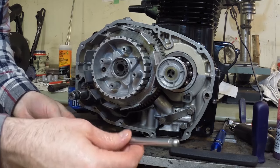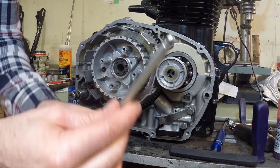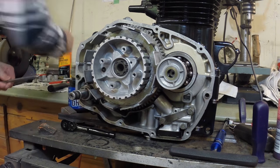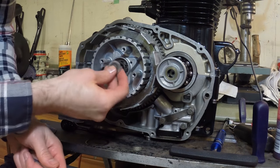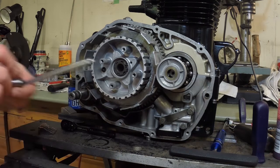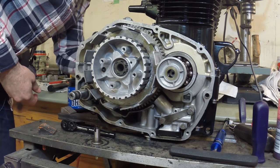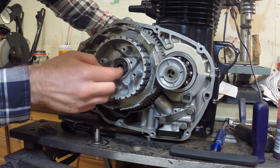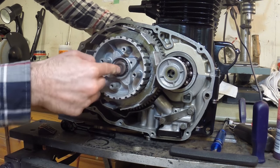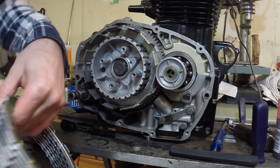The next thing that needs to go in is this push rod — it basically adjusts your clutch from the other side of the engine. It goes through the transmission shaft here. The rod has two ends: a rounded end and a flatter end. You want the rounded end pointing outward. Then this little push crown goes in and butts up against it — there's a little rounded spot in the middle of the push crown for it to rest against. Make sure the rod is nice and lubed up before putting it in the engine. The push crown goes in and butts up against it. Then make sure the friction disc goes in first.